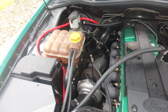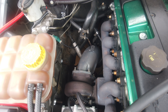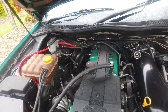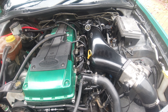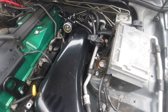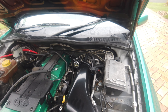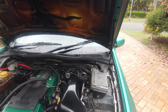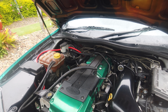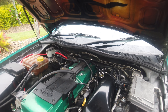Going back is a four-inch dump pipe into a three and a half inch exhaust system right through with a single muffler. For the rest of the fuel system, I've got a Plasma Man surge tank with twin Bosch 044 fuel pumps, and also a 460 in-tank pump with a bit of modification to give it more flow so we can get the right fuel pressure up top.